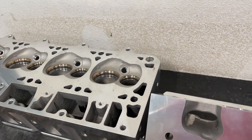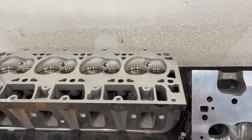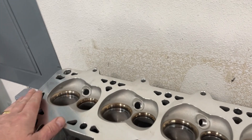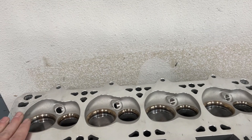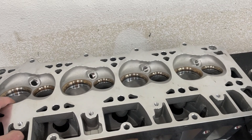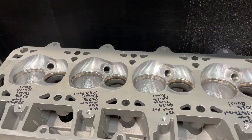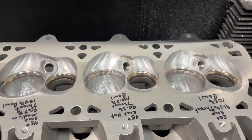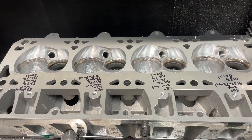Now I'm going to show you the actual milling process on the head. Here at 50 thousandths you can see it's starting. At 100 thousandths, angle milled — still not even close. Watch this part start going away. Here we go for another 50 thousandths — that's 150 thousandths. This is 200 thousandths. See how much is angled on the side? Keep going.